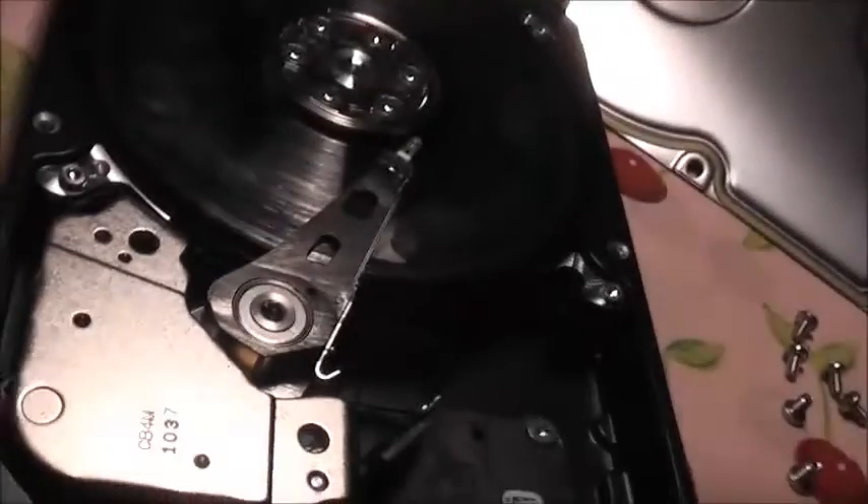I'm going to show this little black plastic thing here in great detail. That's a click and clunk - that's why this drive always clicked and clunked, because there's like a little brake in there. It takes a bit of force to get this to unstick. It's like a little parking brake, a mechanical interlock inside this thing. When the head parks, this thing pops out, sticks to a magnet, and locks it in place. That's what made a clunk in this drive whenever I've used it.